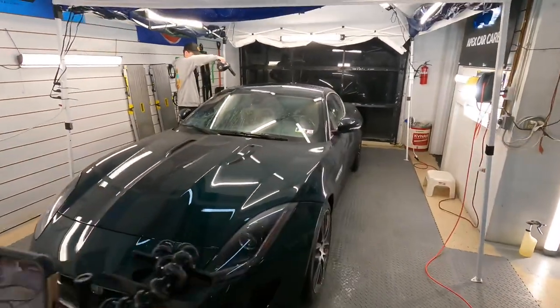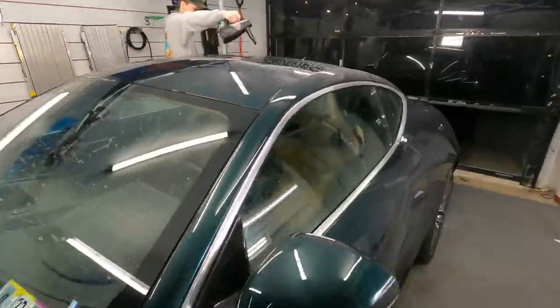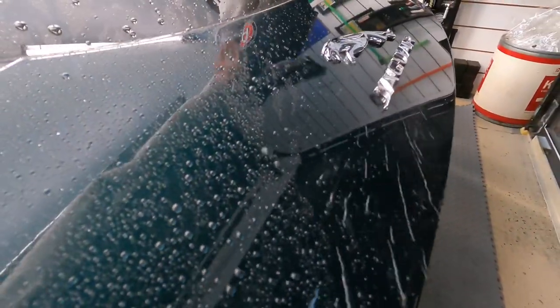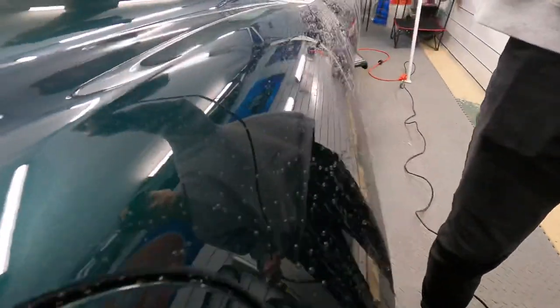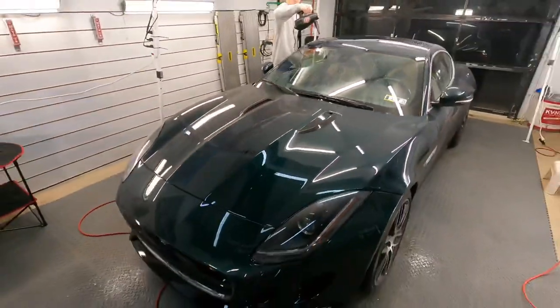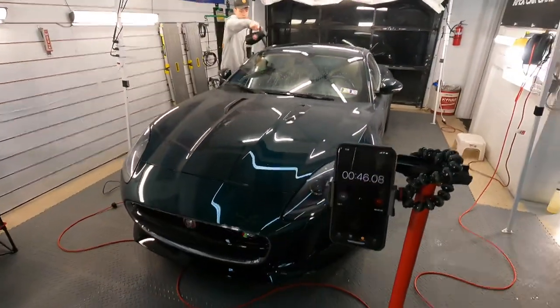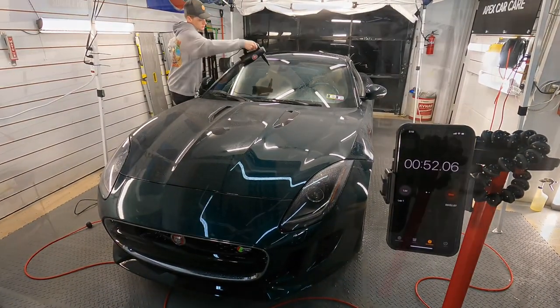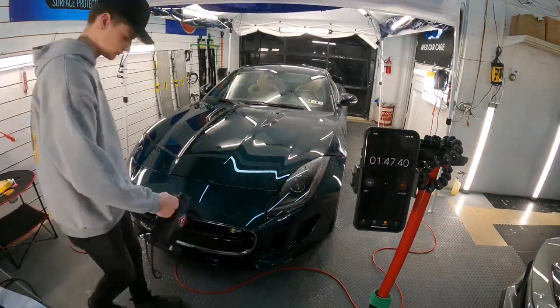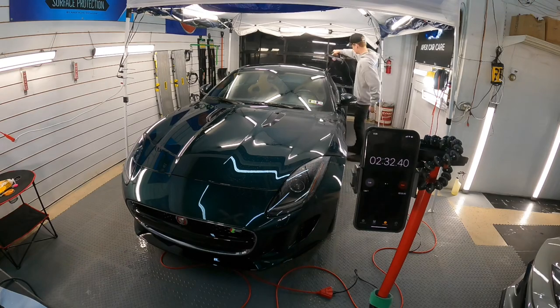Keep in mind that as soon as you're finished washing your vehicle — whether inside or outside — dust is floating through the air and will start to land and settle on the surface. Even if you're quick to grab drying towels, there's always a chance of some dust or grit getting between the drying media and the surface, causing marring. Coatings are not impervious — they can scratch. PPF is not impervious either — they can scratch, though some have self-healing abilities. Let's just prevent all that damage and use forced air.